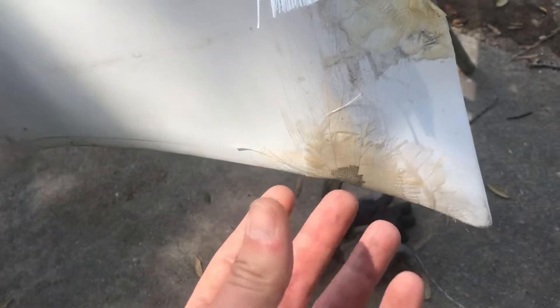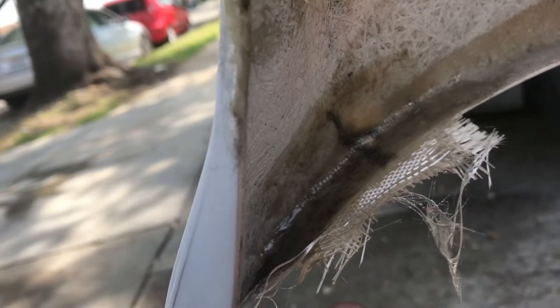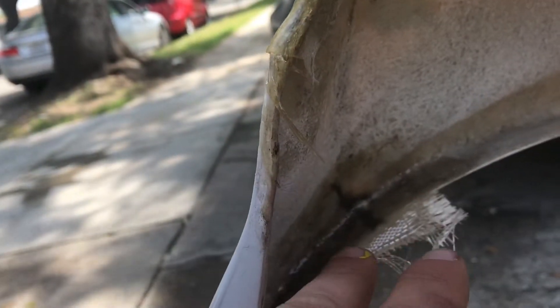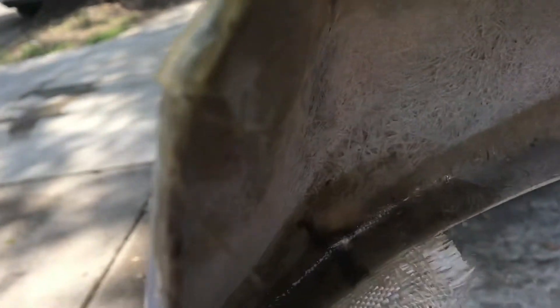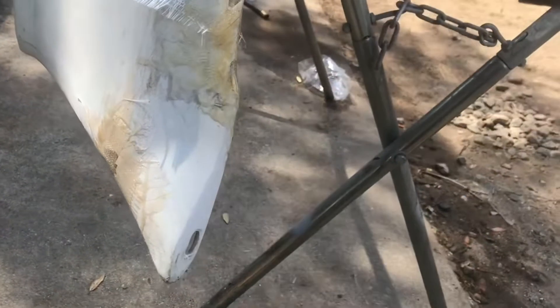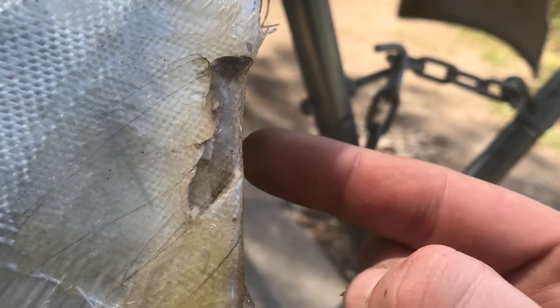Okay, so I got the fiberglass on these cracks. This part was so split that if you were to move this part and this part, it would actually wobble. So what I did for K-Way was I put two pieces here on this side and then two pieces on this side on the inside. And underneath right here, where this whole piece is gonna have to be cut once it hardens, this is three pieces on the actual underneath so that way it won't crack. Because there's this dark spot — that's where the crack is. And if I put my hand on this side, you could see me covering up the hole where it was. So after that is done and hardens, gotta sand all this. I put some fiberglass here to try to fill this in. The rest I can't do.